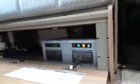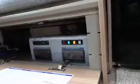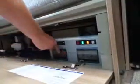Down here is your consumer unit. The lights on top are all switches. There's a spare one not connected to anything, then heating and hot water — that's the isolator for your electric heating and hot water. The charger button switches your charger on and off — you can just leave it switched on and it will charge your battery. The reverse polarity light checks if polarity is reversed; on the continent wiring is sometimes different, so if that light is lit you'll need an adapter. It won't damage anything — just pull your electrics out. Bottom right are the 240-volt trips, bottom left are the 12-volt fuses with labels showing what they're connected to.